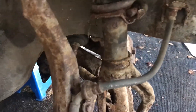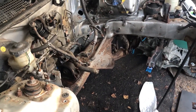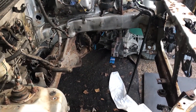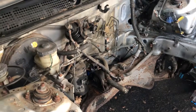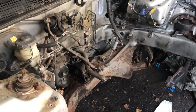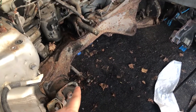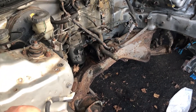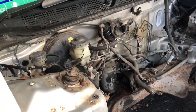On the other side I just pulled it out and cut the end off, because it's a different shaft anyway — different gearbox for the 18. Once they were out that allowed me to reach everything else. The exhaust was off, so it was just a case of taking the final few bits off. I left the alternator and starter motor cables on until the engine was lifted up a little bit, as it's a lot easier to get to that way. The gear linkage just unbolted from there, but I cut the other one because it was a bit stuck — and again, that'll all be changed because I want everything fresh anyway.